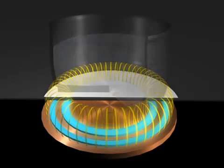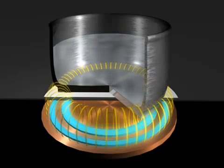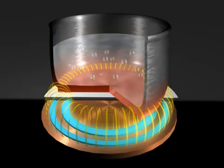However, once you set an iron or stainless steel pan on the burner, the magnetic field induces many smaller electric currents in the pan's metal. Iron is a poor conductor of electricity, so as all these small currents run through the iron, much of the energy is converted to heat. Thus, on an induction cooktop, the heat is coming not from the burner but from the pan itself.